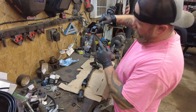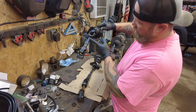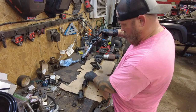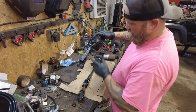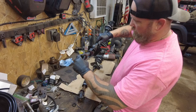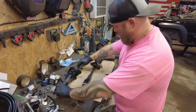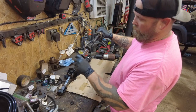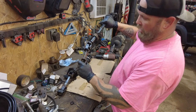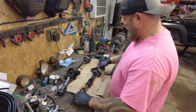I think I'm going to cut it about 1 inch down and then get a piece of this shaft off of this one here, extend it about as far as I can, and with the slip, I shouldn't have to be too precise. The one out of the one I'm building was a running and driving Liberty, and the shaft on this thing is completely locked up, so apparently they don't move a whole lot. So I think I'll be fine. So that's what I'm gonna do.